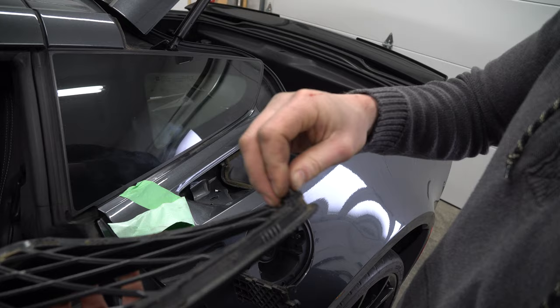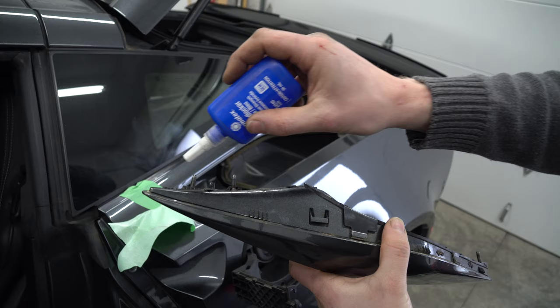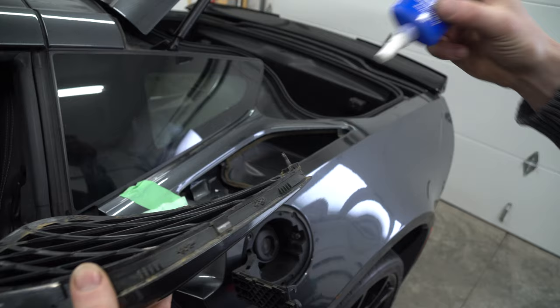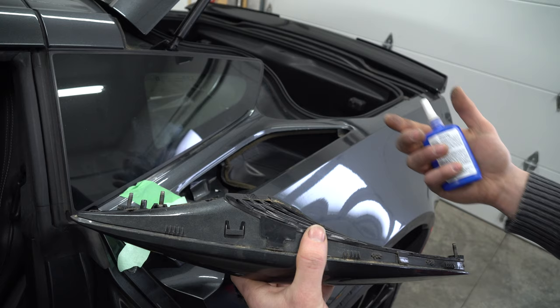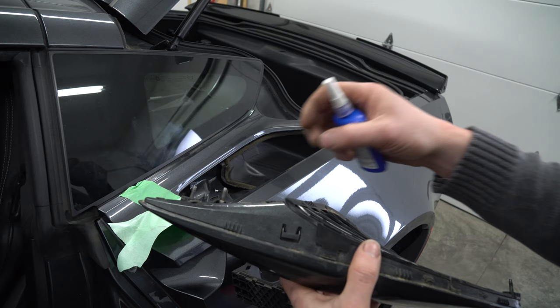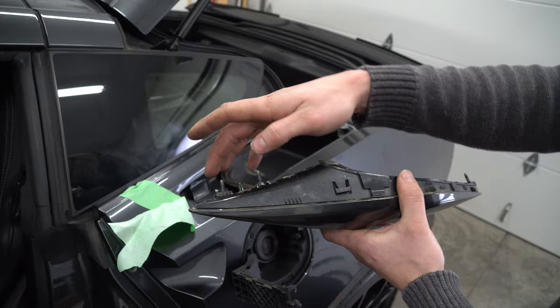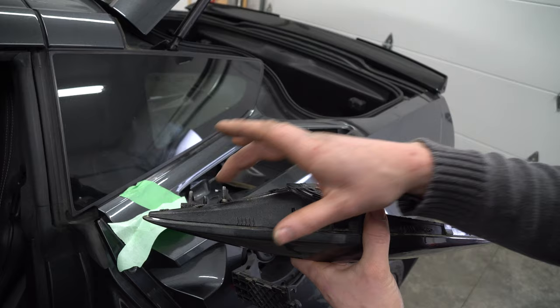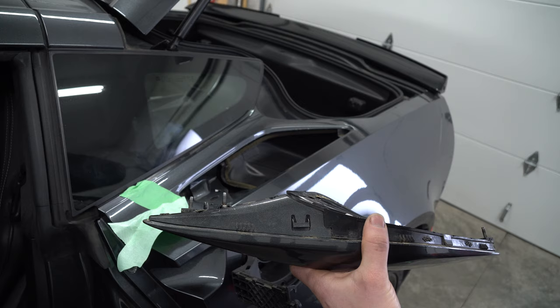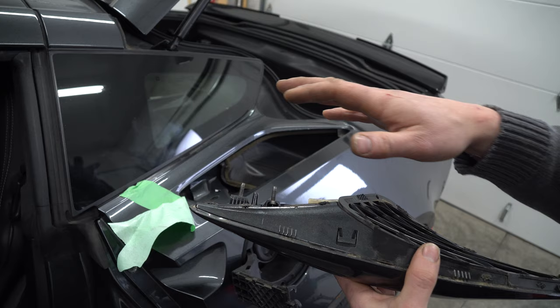What I would suggest you do is take a little bit of blue Loctite and put it right here, a little bit there, a little bit here — just a small line of it. What this allows is for the nut to actually sit and not fall out later, because you've got to be very careful with the torque on these nuts. A lot of people find only two nuts because one has already fallen off from the factory. This fights vibrations. If you want, you can go even less — there's a yellow and a purple Loctite. Go as low as you can. This is only plastic, so don't use red or orange — you'll never get it out and you will break this.